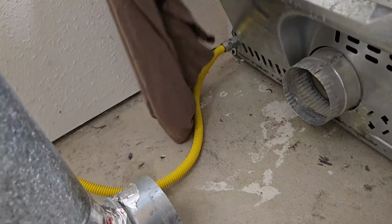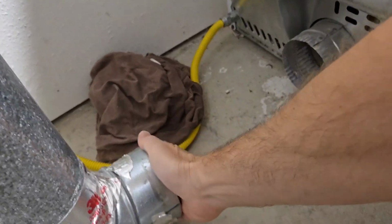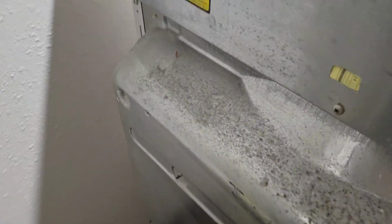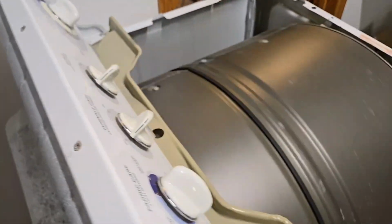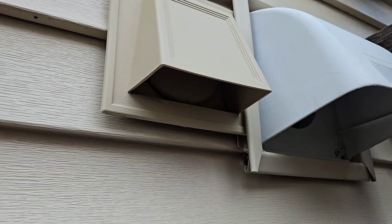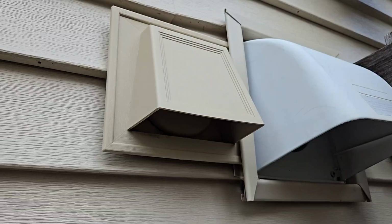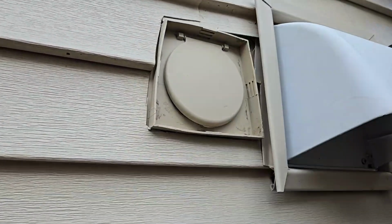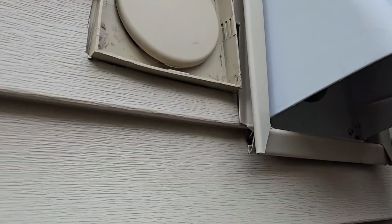We recently had the house resided and the dryer flap outside wouldn't close completely. With the hot and humid air outside, this caused air to be drawn in from the outside, cooled down and condensed through the dryer vents, and the condensation accumulated inside the dryer as the air was drawn into the house. I ran the dryer for a while and then the beeping noise got quieter and totally went away, but the dryer still didn't continue to heat.